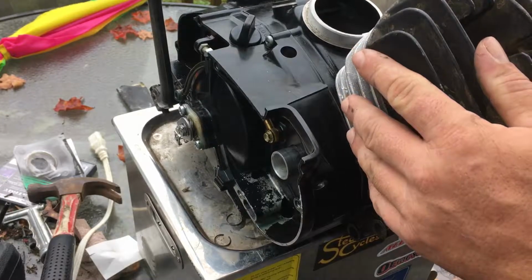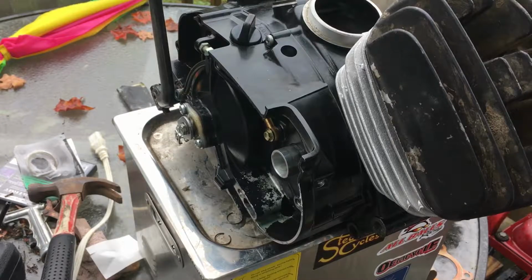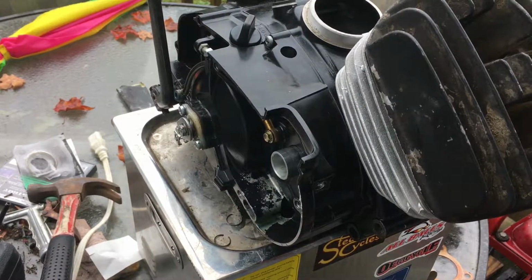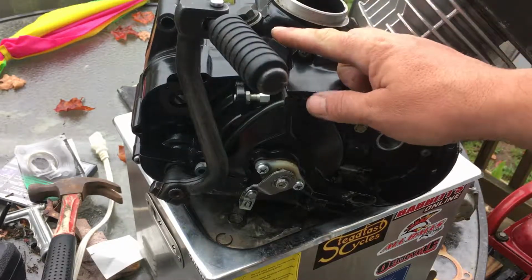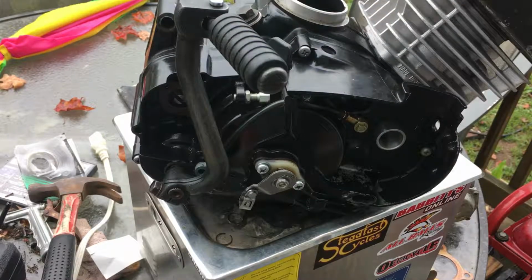So this is for the KE102. We're going to be soaking the clutch discs in friction modifier, which is what the Ford uses in the rear axles, and it's going to sit in that for 24 hours. I might even go longer. I'm going to teach you guys about that. Friction modifier, if you have a slip-in clutch, you could throw like half an ounce in your oil and sometimes it helps you out. Get you a little bit of fun time with it.